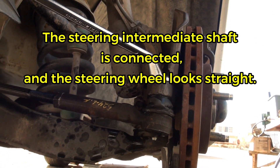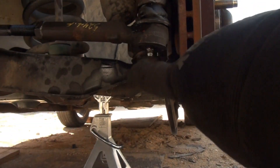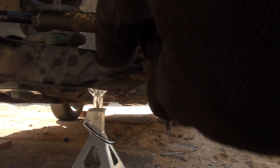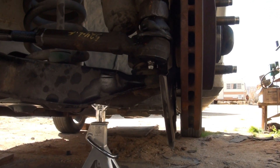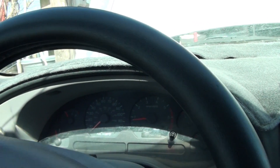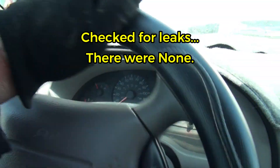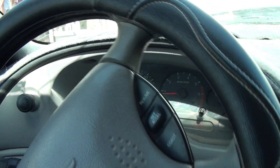A 19 fits these but I think a 3/4 fits them better. Now I've got to grease both sides a little bit, and I will be replacing these later on — I just want to see if I can stop the noise in the steering and add a little fluid to the reservoir and give her a test. I might hear a little growling, but that's the power steering. I think it was the outer tie rod end on the driver's side. I'm a happy camper.